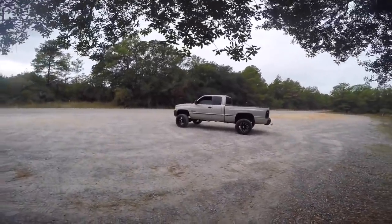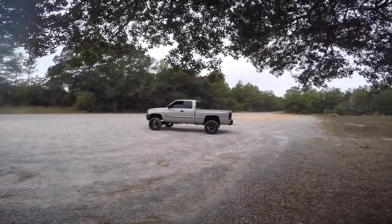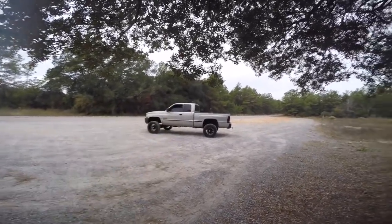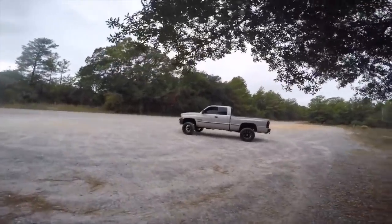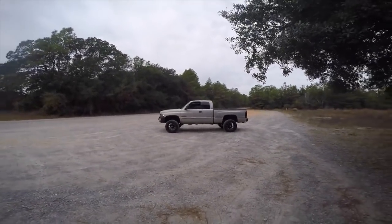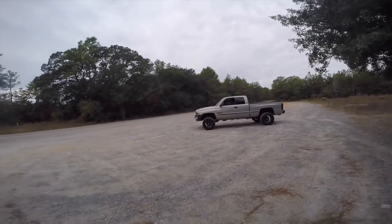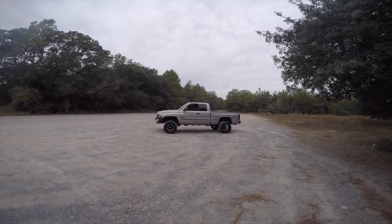But like I said, this isn't a video I would have normally made. I just figured while I had the sway bar off, I would say my opinion on running a sway bar and not running the sway bar and the differences I can tell between not running it and running it. I think my brother, as a matter of fact, doesn't run a sway bar. You can go ask him. I think when he did his leveling kit, he went ahead and just left his whole sway bar off because I think his sway bar end links were too short. Mine were too. I just happened to put my sway bar back on and just stretched the end links as far as I could. And as you can tell, it didn't work out. The bushings just ended up blowing out on me.